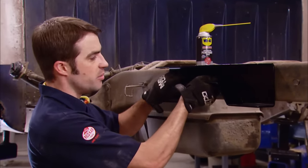We're using a 40-thousandths-thick cutoff wheel from Industrial Depot on our four-and-a-half-inch angle grinder, but you can use a reciprocating saw and achieve the same results. Our cutoff wheel got us through both frame rails. If you're doing this at home, make sure you support the back end of the frame rails before you make your cut, so the frame rail doesn't move around on you once you remove half the metal. That way, you can bolt the C-notch back in place and lock it into position nice and straight. With the frame rail carved up, throw the C-notch plate back in position and verify that the holes you marked are in the right spot.